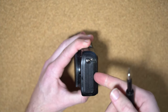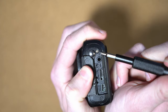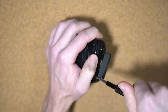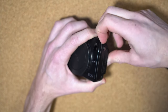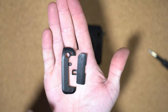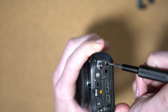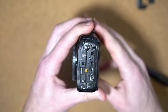We start on the port side. There are three screws to remove: one at the top, one behind the port flap, and one at the bottom. Unscrew them and the whole panel should just pop off — you might need to pry it with a flathead. That gives you two pieces you can set aside. There's also one more screw at the bottom on that side that needs to come out.